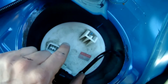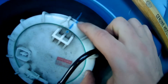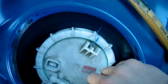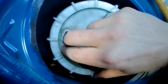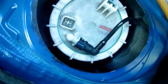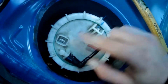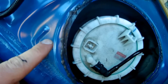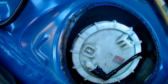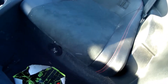The next step is to put that black gasket around the hole of the tank and then press this top in — it should stay like this. Now we're going to install that washer and lock ring. Now that we've got the ring lined up with this and that dot, we are going to connect the fuel line. Make sure everything's lined up in there — it's snug. Now we're going to connect this power to that and put a little bead of gasket maker on there. We got our bead down there, now we just connect it and put it back into place. I got the bolt put back in and the seat back on, and now I just have to fill up on 93, prime it, and then start it.